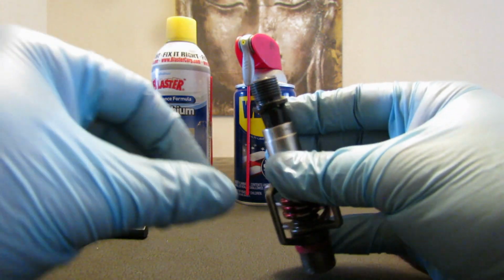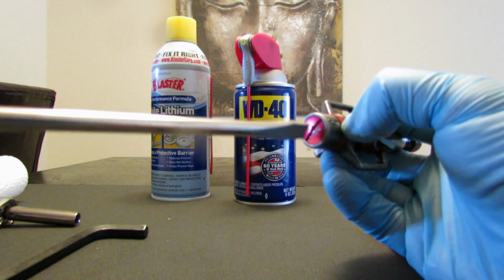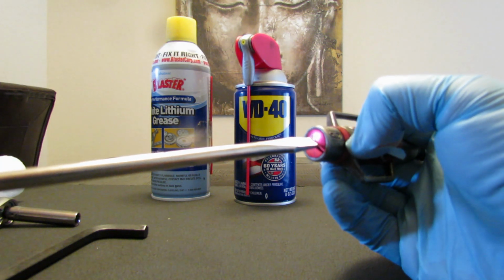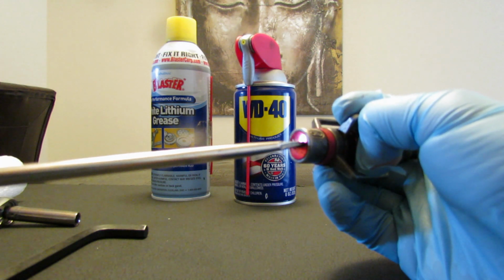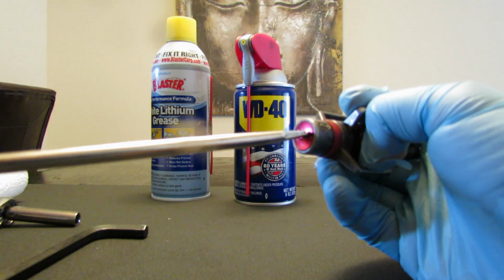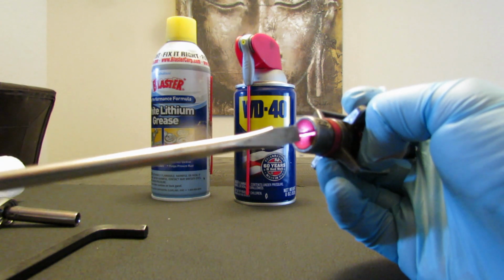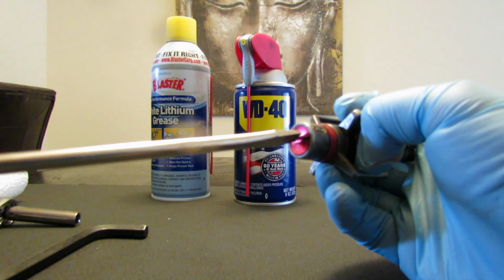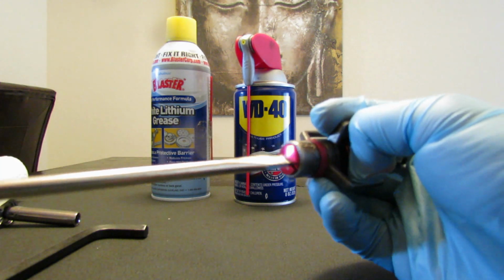One thing that I did was loosen this one with a flat screwdriver, and what worked for me is that it was easier to do it on the bike. This one was pretty tight, and you don't want to mess with it too much because it's very easy to strip. I wish Crankbrothers used another system, maybe a Phillips screwdriver or a hex, which would work better for this. I mean, this is very easy to strip. So anyway, I'm going to keep loosening this.